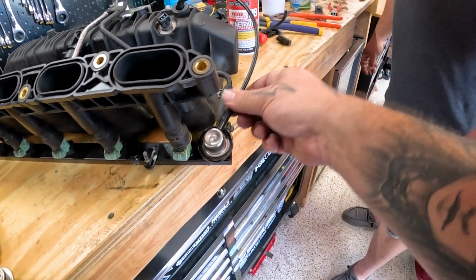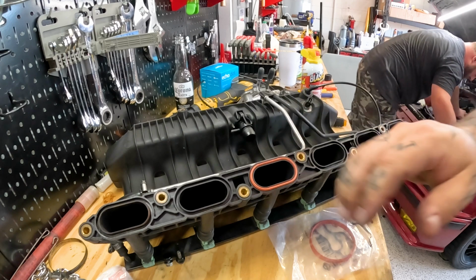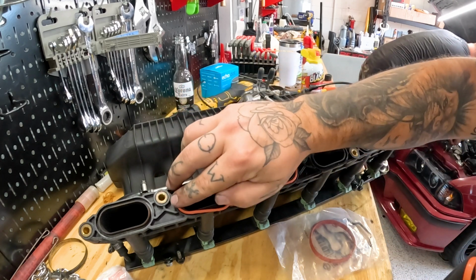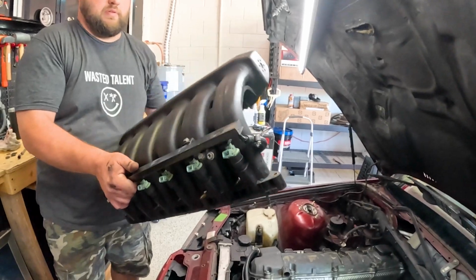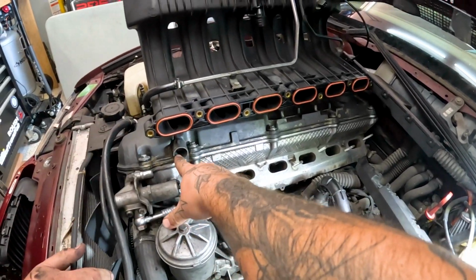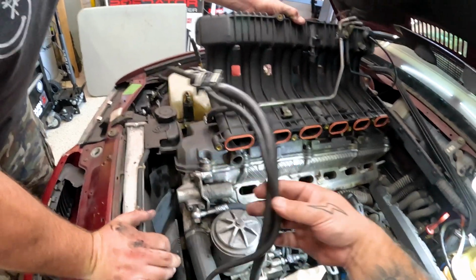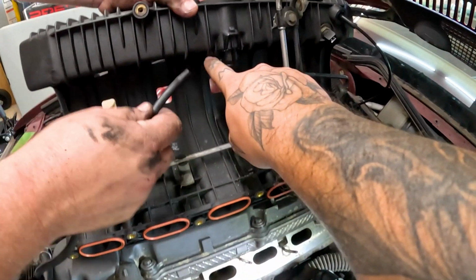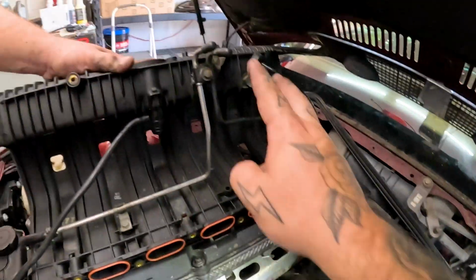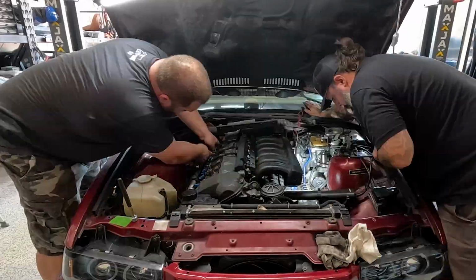Bam. Vacuum, don't fail. New gaskets for the manifold. On the cylinder side, we got a couple things to reconnect on this line that goes from the top crankcase, so here to there, which is going to be this one here, so that plugs in, and then this runs under, goes to there, fuel lines there, connect there. The idle control valve here, which goes to there.